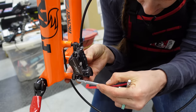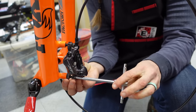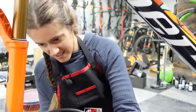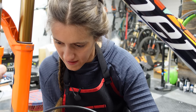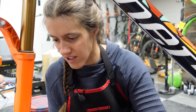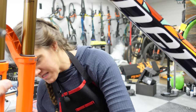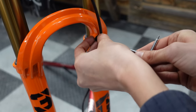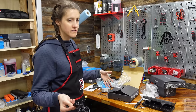On the front, we don't need an adapter because this fork is set to take a 180mm rotor — if we were doing a 203 we'd need one. Whenever tightening a bolt into the frame or a fork, be careful not to mess up the threads. You're running on the inside of your fork, not the outside. The next thing is putting the brake levers on roughly where they'll go so we can decide how much hose to cut.